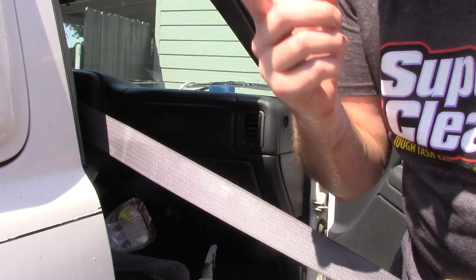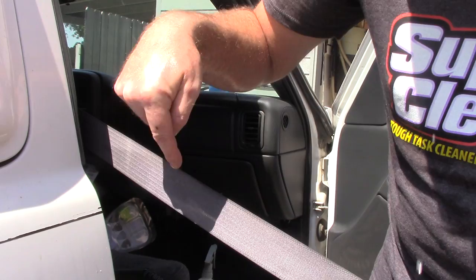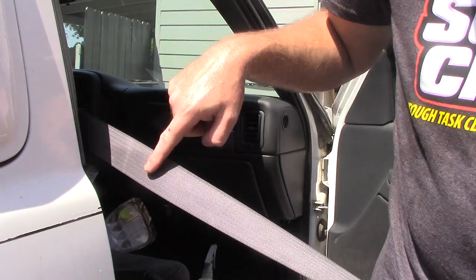Hope that helps you out. I know the first video I did was kind of brushing over the topic. I just wanted to show it in action how it absolutely works. It works great. Get that nozzle right up against it if you have steam. That works really well. And blow that steam through the belt with a good degreaser.